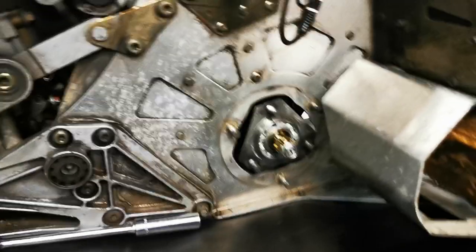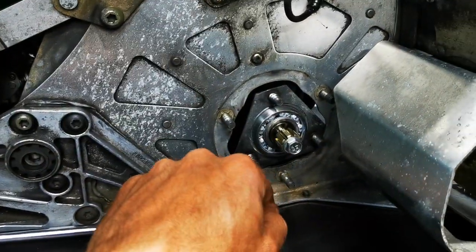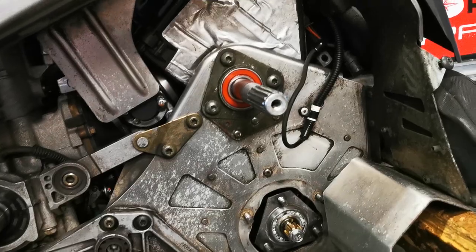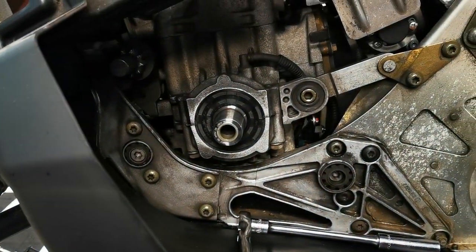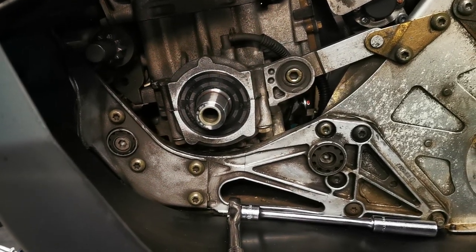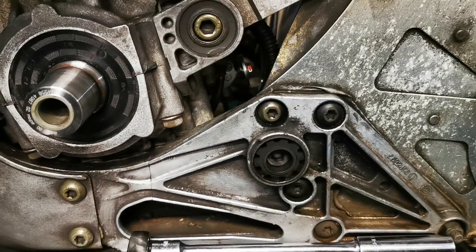Up until last year there was some confusion on how to grease the drive shaft bearing, which is the lower one here. So obviously I've had to remove the primary and the secondary clutch. The secondary is just held on by the bolt that goes in the end of the shaft. For the primary you obviously have to purchase the proper clutch puller to take that off, and every year I do this you can tell it's time to do the motor mounts again as well.